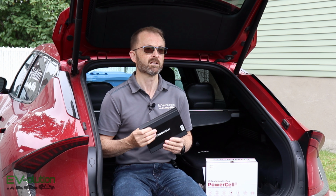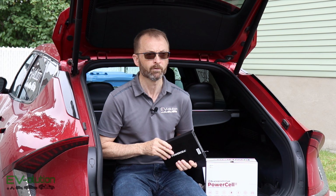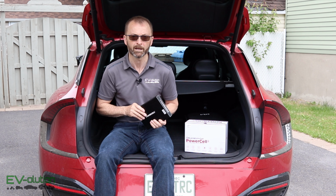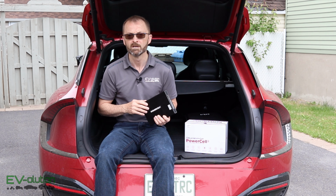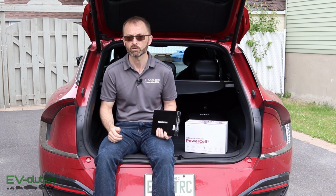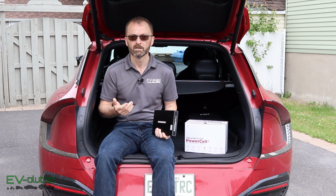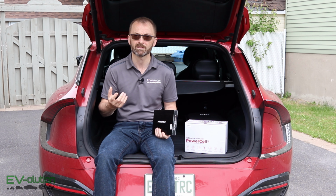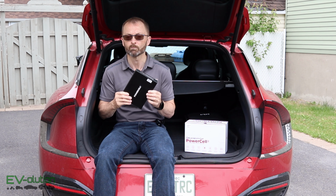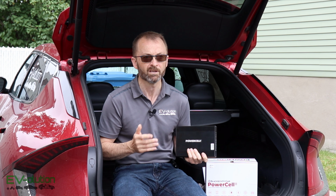Now, what about the question of an electric car? Well, an electric car has a giant high voltage battery underneath it that protects and maintains your 12-volt battery. Now, as I mentioned earlier in this video, the Hyundai and Kia EVs had a 12-volt battery maintenance issue because of the programming of the software. Well, since recording that portion, I've had my car updated and the latest software maintains the 12-volt battery much better. Does that mean that this becomes useless? Well, not really, because in the winter when it's cold, your 12-volt battery is still maintained, but having that extra load on your 12-volt battery, when it's minus 20 degrees, I'd rather have some protection having this battery pack between my 12-volt and my dash cam to make sure that my 12-volt doesn't take any major hits.